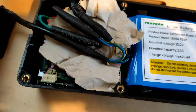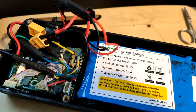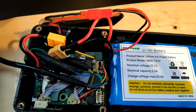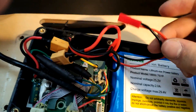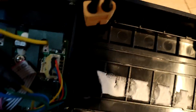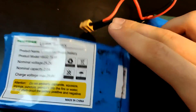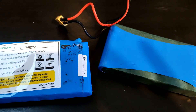So we're going to disconnect this from here and take it apart. You want to disconnect the battery from here, and then there's another connector under this little cover that was actually stuck at the bottom. Just get it out gently, and cut this off so we can disconnect it. That connects to the charging port there. The battery's also stuck down, but I have removed it before, so it should just come up and out. This is probably the worst part of this because it's quite dangerous opening up a battery, so you want to be really careful and not cut into things you shouldn't — just take your time and do it slowly.